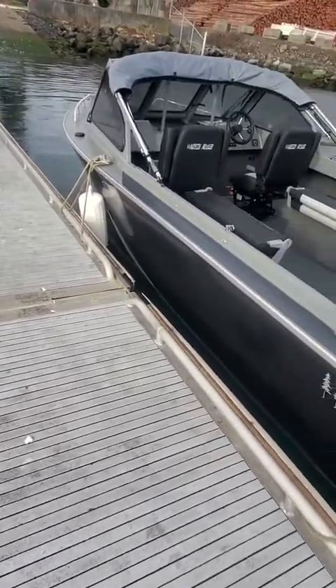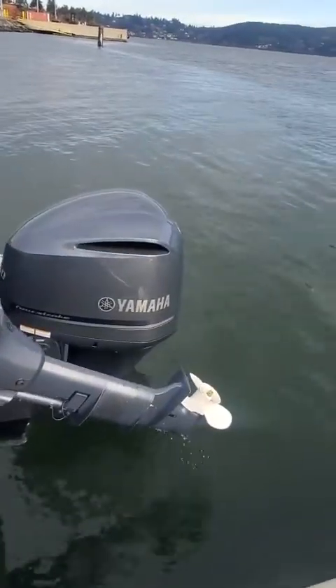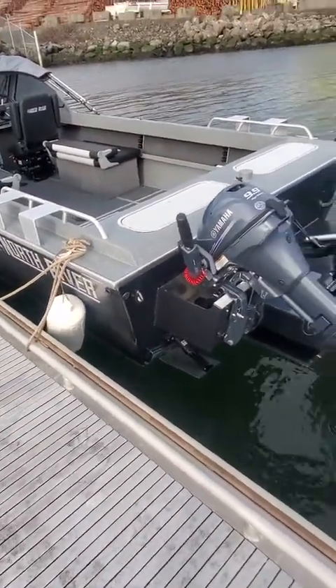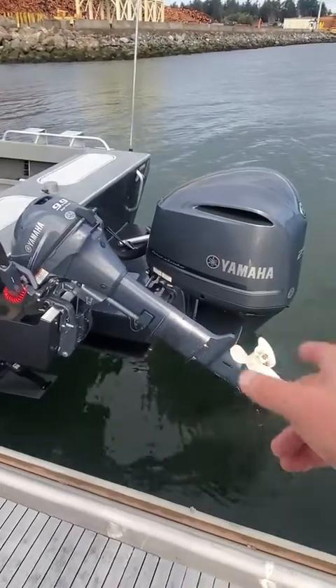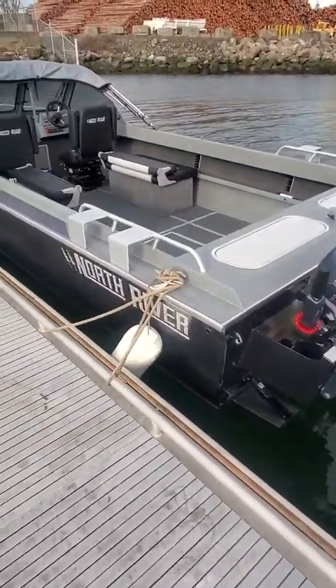You can use regular ethanol, but I put 40 gallons of non-ethanol with Startron. No matter what you do, put Startron in it — it's one ounce per 16 gallons. The boat sits really good in the water. I'm going to fire these things up pretty quick. Got the bait kit on here, and I'll be nice to your boat — trust me, I'm not going to hurt it.